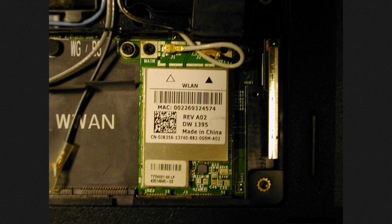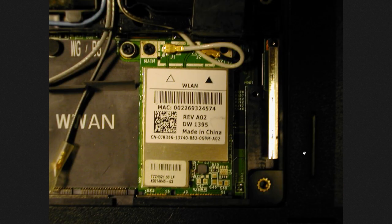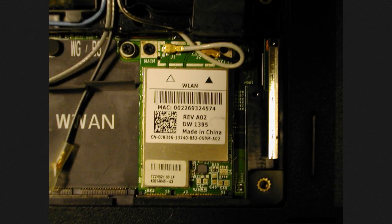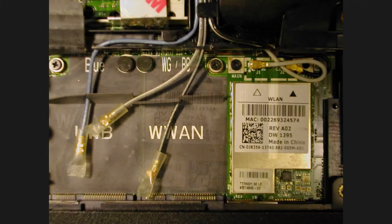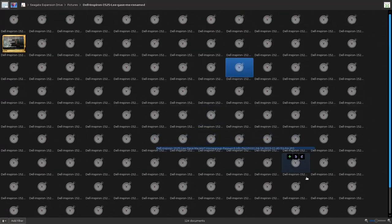There's the Wi-Fi card right here. It doesn't say broadcom on it but I know it's a broadcom — I must have looked the numbers up. You need to know the chip number somewhere. There it is — it's a DW 1395 broadcom. I don't remember how I found out it was broadcom anymore. Let me look up '1395 broadcom' in Synaptic — we didn't get any results.